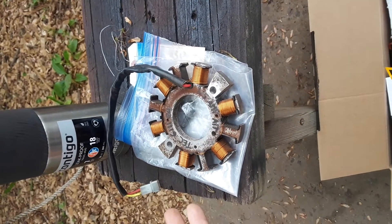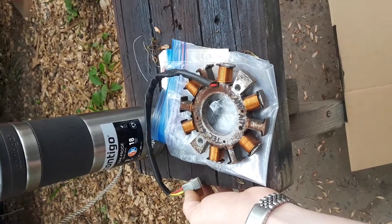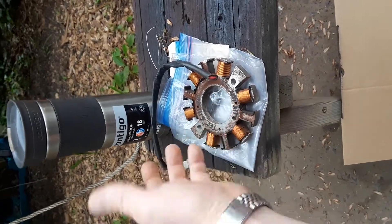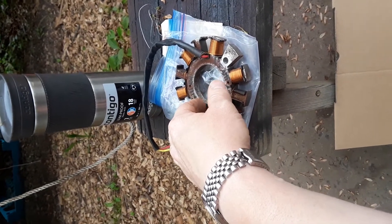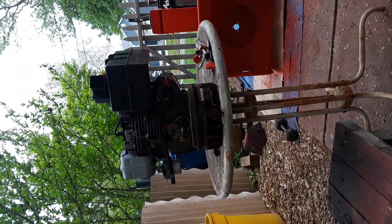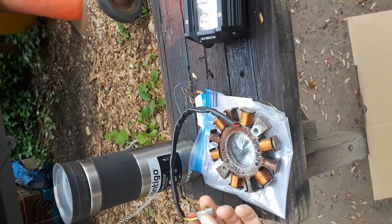That eliminates all the extra wiring — bridge rectifier, fuses, capacitors — and makes life so much easier. So if you already have one of these alternators, either laying around or on a snowblower and not using the DC end, you can plug right into it. Or if you have one of these older snowblowers and want to upgrade to an LED, you can get this alternator on eBay for about $40 to $45 plus about $5 shipping — so for $50 it bolts right on. Red wire to the red on here, which is your DC, black to ground, and you're good to go.